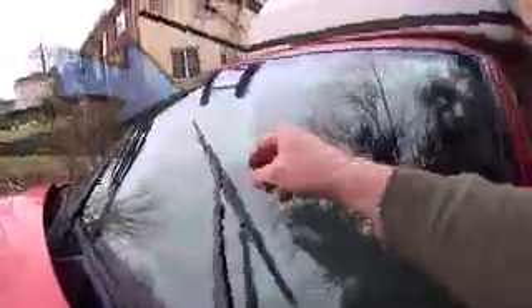The way to make this easy is that most of the time the wiper blades are gonna tuck down behind the cowl. So the easy way to do it is you turn your key to the accessory position, turn your wipers on, and you want to shut the key off and stop the wipers like halfway up the window. That way you'll be able to reach the part you need to get the wipers off.